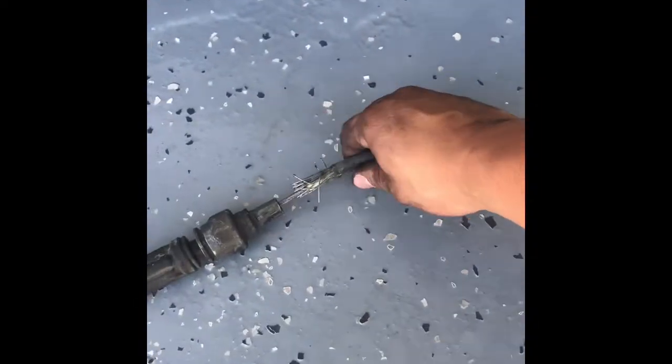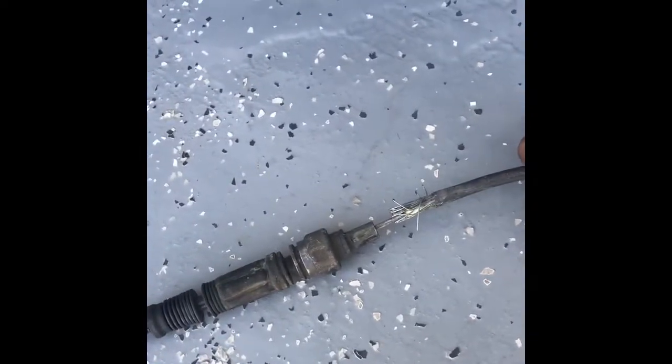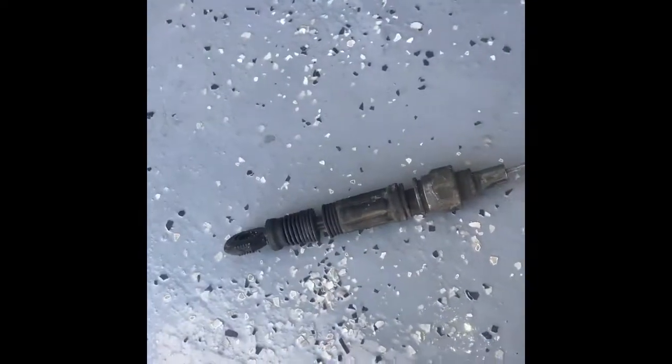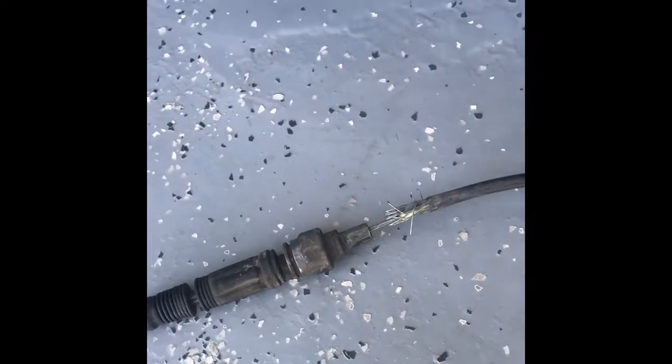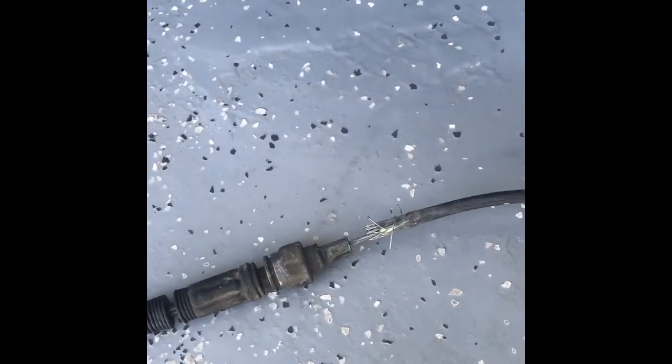We've got, right here, the upper cable that we pulled first. Both have white ends, and then this darker black end here is where we could see where it came apart on us, and where it wasn't pulling it out of gear. So now for install. Install is just the same as this, just in reverse.